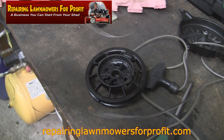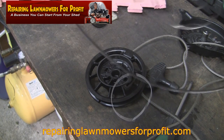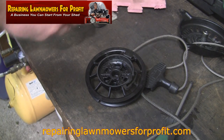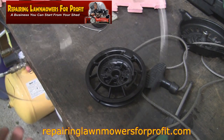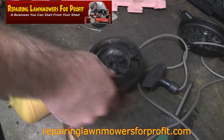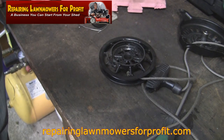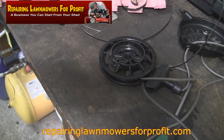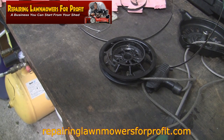And as you can see, it's completely unwound itself, which I was suspecting it might do. Getting that back in is a real pain. Rewinding this spring and actually trying to sit it in there is going to be quite a job. I'll have a little go at that. But this is why I normally spend an extra £10 and just buy the whole recoil. Three bolts later it's on and I can list this for profit. But I'll have a go at rewinding it and putting it on.